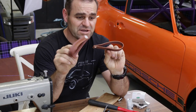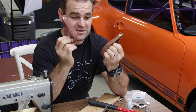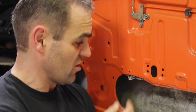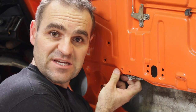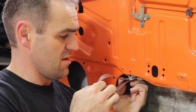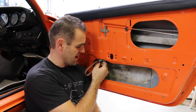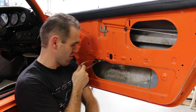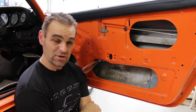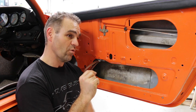They're done and they look pretty good. I am quite happy with how they came out — nice neat door straps with the purple stitching. So they're my new door pulls for the inside of the car. Now I'll show you how I'm actually going to attach them. Inside the door, this is where the factory latch was connected. Basically what we need to do is pull this little lever and attach this on, and there's your door pull. I just used a little M5 nut and bolt with a couple of washers. I did use a bit of thread locker because I'm worried about it eventually undoing, so hopefully that will keep it nice and solid. A quite simple little change and a nice-looking door pull. Now I'll put it on the other side and then I've got to work out where to put the hole through my door trim.